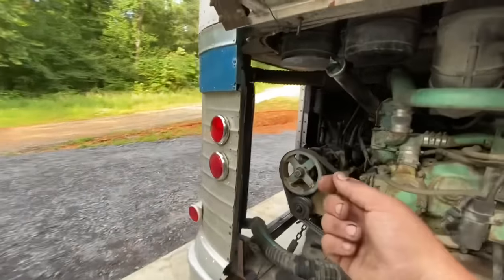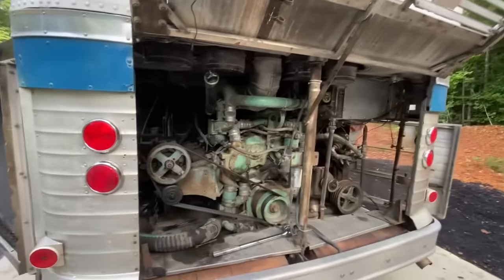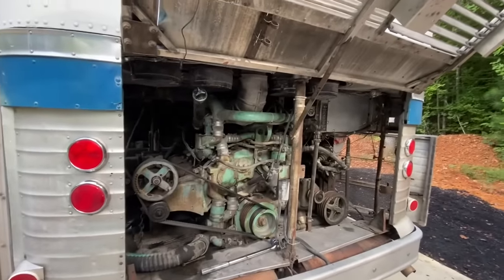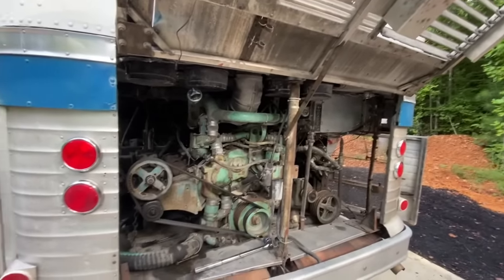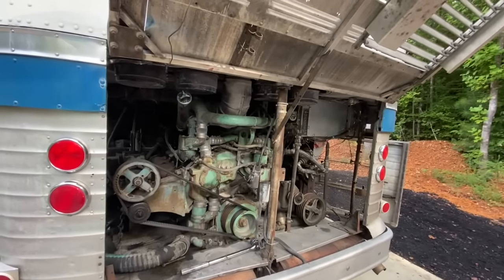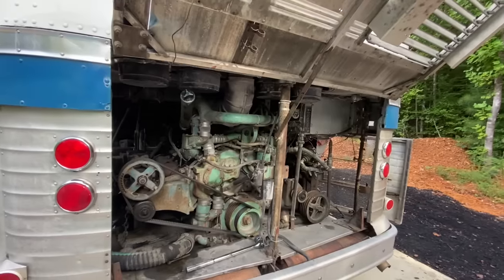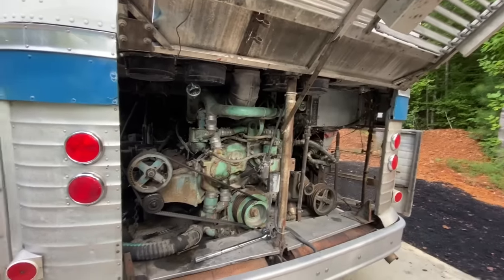When I had the feeler gauges in there, all the valves were all over the place, the settings on them, and I hadn't even checked the injectors, which I assume are probably the same. It's not just going to be like that on one side and not the other. I think it's got 40,000 miles on the rebuild. It's probably never been tuned up after that, so it's just wear and time would be my guess.